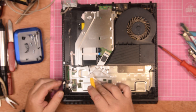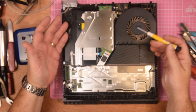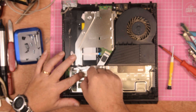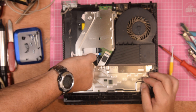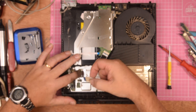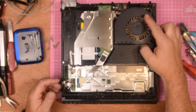Let's put that to one side. You can see we're now coming to the nitty-gritty of the board and there is dust over quite a large amount of this board. To take the next bit out is fairly straightforward. First, we have to remove the Wi-Fi antenna connection — that little thing here — it just clips up with your fingernail. You unhook it from these clips; just remember where it was routed. Also, you need to remove this particular connector, which will unclip. Then you have to take out this cable here — you only need to take it from one end; just push down on the metal bit and it will unclip from the connector. While we're here, let's just check that the fan isn't seized — and as you can see, the fan does spin.